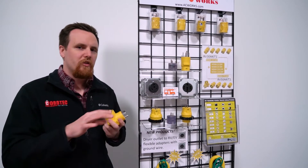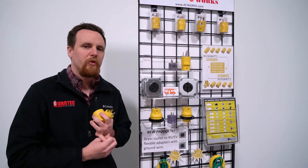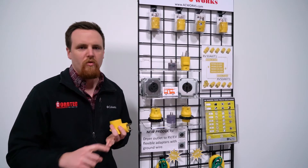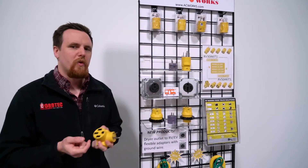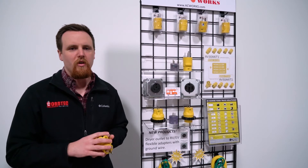So you'll have to adjust when using your 50 amp RV on a 30 amp outlet. You won't be able to use high-voltage appliances like an air conditioning unit, an oven, or a high-powered microwave. You'll only be able to use 125 volt appliances like your TV, refrigerator, and other small things.